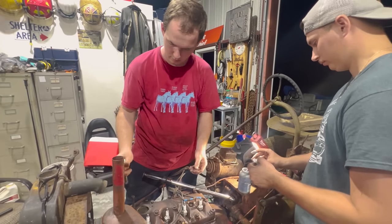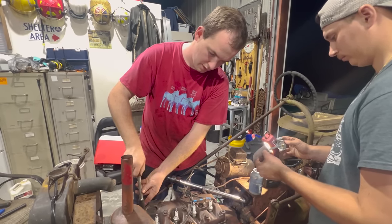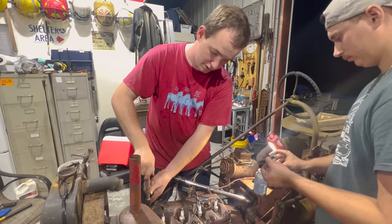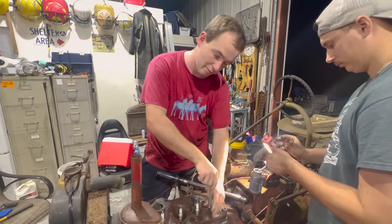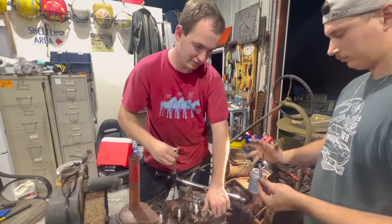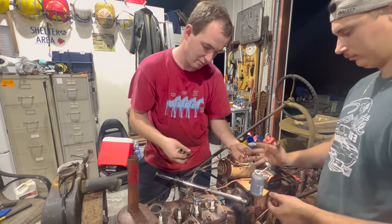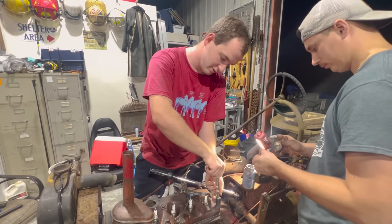What's so bad about these engines, these Farmall engines? Why do you need that never seize? So almost every single one of these bolts go directly down into the water jackets. Water, metal, rust, so it basically welds itself to the block with all the rust and crud that builds up on them. You think that was our problem with that? It was absolutely our problem.